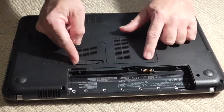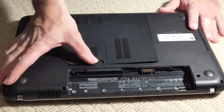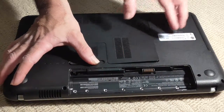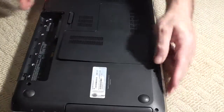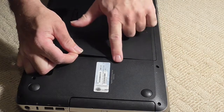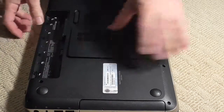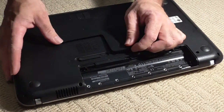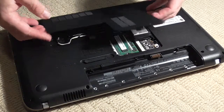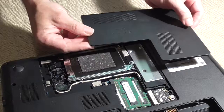Press the lever a little more and this cover is going to pop out. Push it in the other direction — and you can see it popped up a little bit. Go carefully; when working on electronics, don't grab things like most people do. Take your time, be patient, use your fingertips, and wiggle slowly to separate and lift the panel.